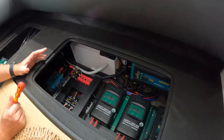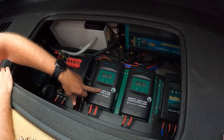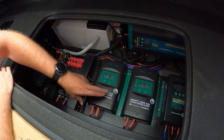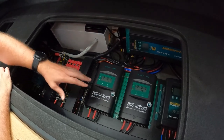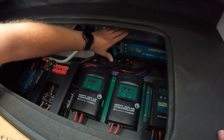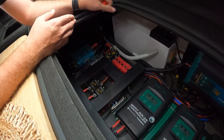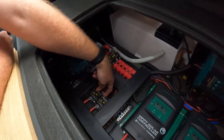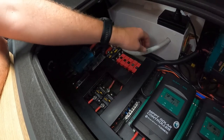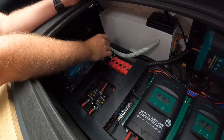This one here is one of our new C-Zone boards — a really cool new system. You've got two of our new MPPT 40-amp solar controllers. These two are actually producing some pretty wicked figures right now — we're almost offsetting the usage of our aircon, including the load of the fridges and everything else in the caravan. One unit is producing 40 amps and the other is just under it. Tyson's particular van has a second DC to DC charger added up top to maximise input while driving, plus a 100-amp AC charger. Going through the business end, we've got two solar breakers — one relating to each controller — as the solar feeds come down from the roof into these units to output current, and then the rest of the fusing for the outputs of our chargers, DC to DCs, and main breakers isolating the rest of the system.